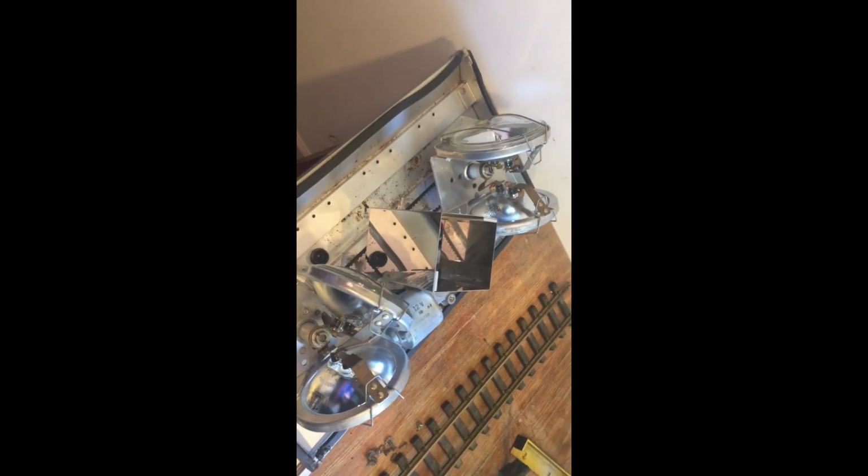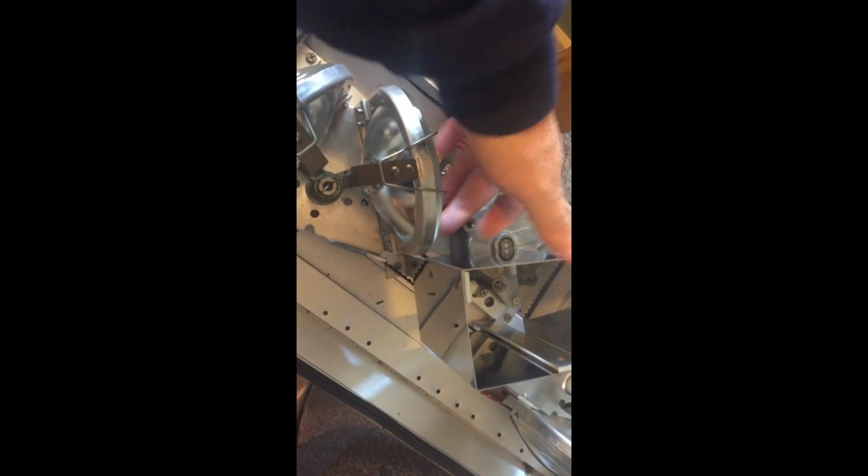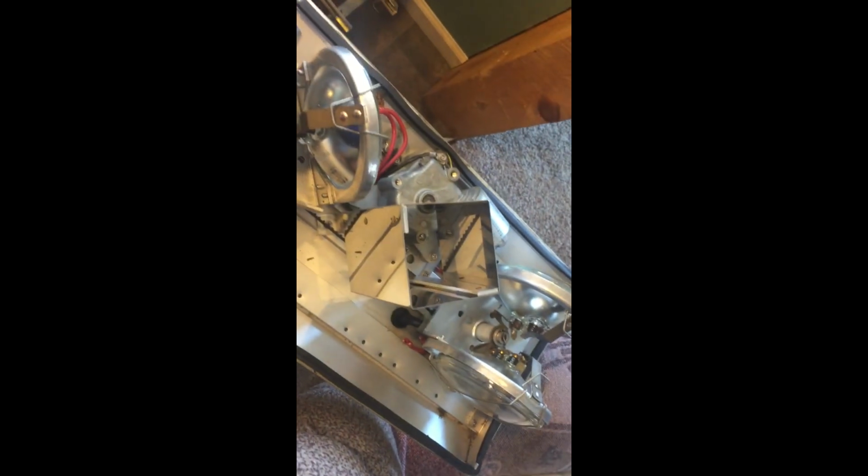Okay, we've got our Code 3 XL light bar. Got the lens taken off of it, and you can see some of the things that are on the inside of this bar. It's pretty clean. Each one of these sections has a motor and a little rubber gear there that turns these light housings. There's a 100-watt speaker, another motor and light housing setup with a diamond mirror. So we'll start taking this apart.